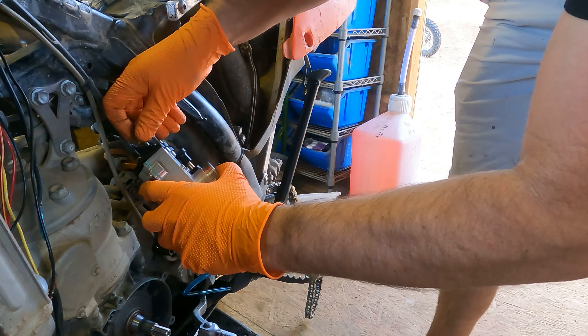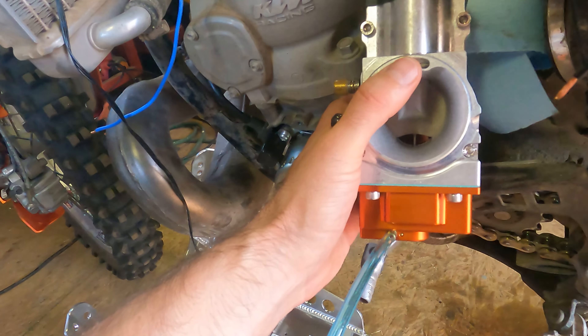The carb goes between the intake boot and the engine. I'm going to get a screwdriver, pull the clamps that hold this in place, and get it out of the way. That boot is cracked and damaged — there's the old carb, and this boot is real badly cracked, so I'm going to replace it.